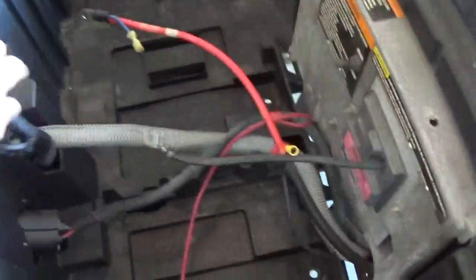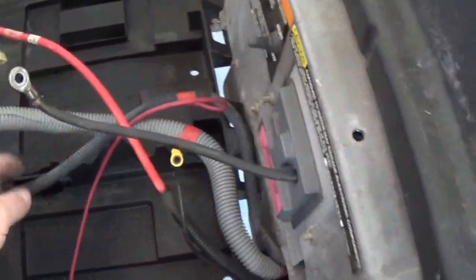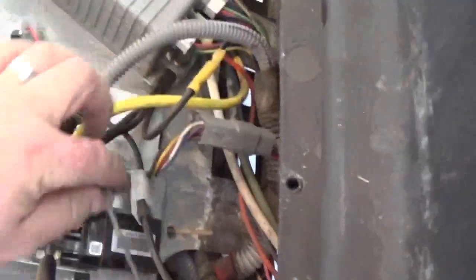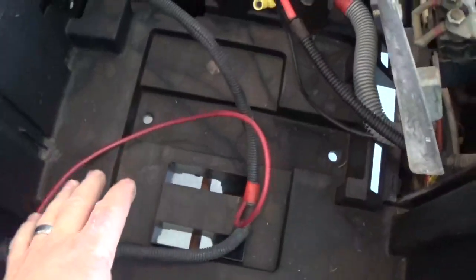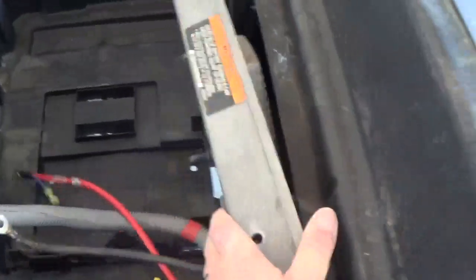I've got the battery and everything out and some of this wiring laid out of the way to eliminate confusion. This is just our positive and negative that goes to the battery. This is our main harness coming out of the control box — this is what we're eliminating, from here back — and you can see it goes back to the controller area. Just lean that forward, don't be scared, follow these wires up. We're just going to unplug the harness from the back and pull it through. That's all that goes back there — that's for the onboard computer for the charger, which we're no longer using. We still have our brain box for the control box for the cart itself.